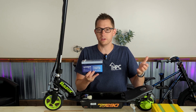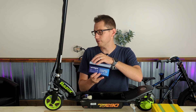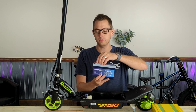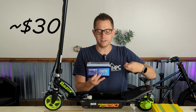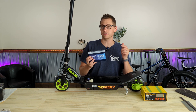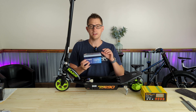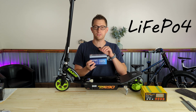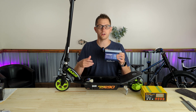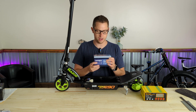Replacing the battery is probably more in line with what you would do at home anyway — if your battery's bad, get a new one. So I ordered a new one, relatively cheap. This is actually better for a couple of reasons: this is not a sealed lead acid battery like the first one. This is a lithium iron phosphate battery, which is pretty much better in every way — safer, lighter, holds a charge longer, more cycles, that sort of stuff. They feel drastically different in weight.